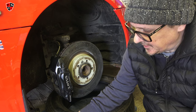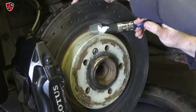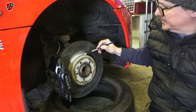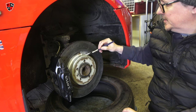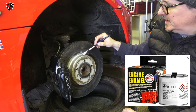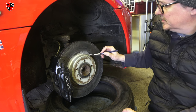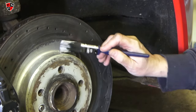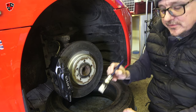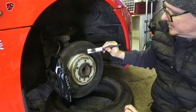Here goes — a little blob of paint on the brush and away we go. It's good because you can rotate your surface and keep the brush in the same place. This takes between 30 and 60 minutes between coats to dry — it's engine block paint, essentially. If you're anywhere where there's friction and heat, like a braking area, you have to wait 24 hours for it to cure. Which is fine for me because the car's not going anywhere.